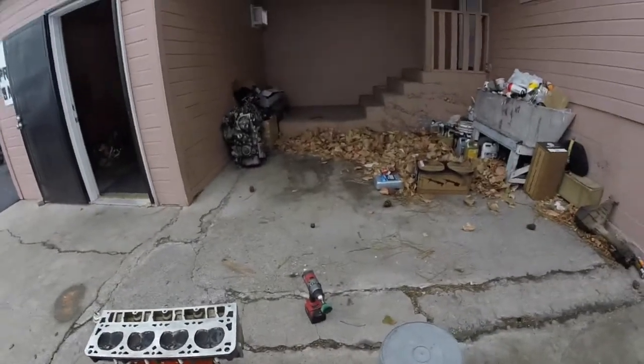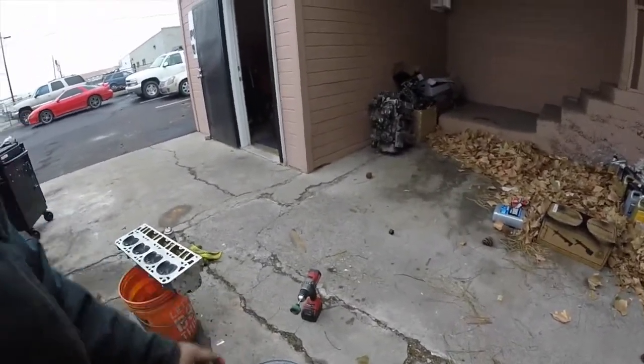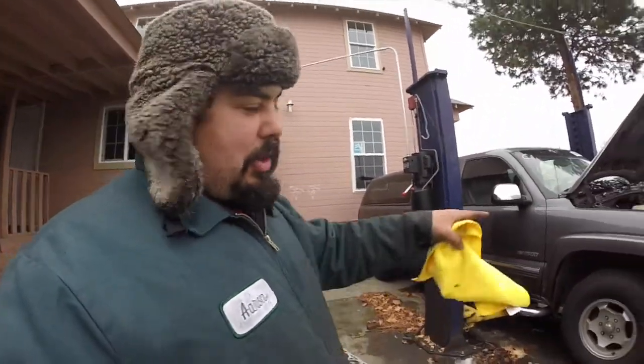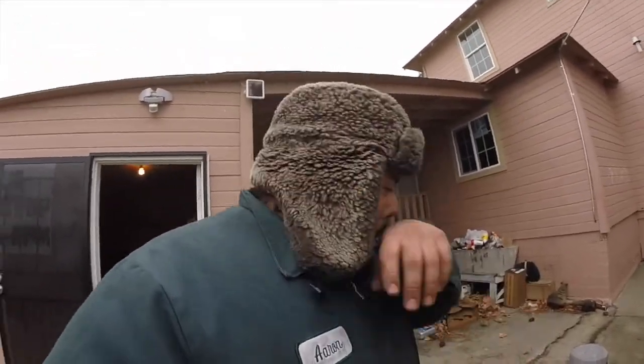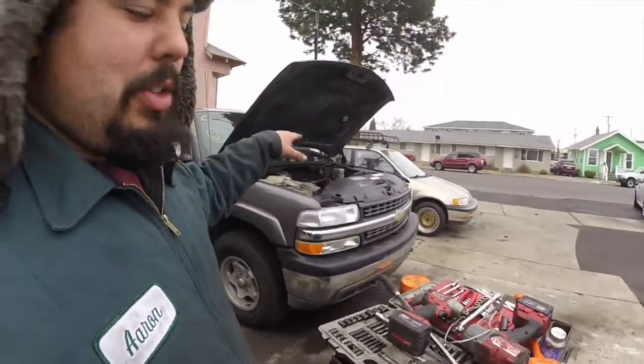So I know what a lot of you guys are gonna say, he Whiz-Wheeled it, and yes I did. I used that little buffer pad there, and guys, I've used that thing 100 times. I've never had a problem, I've never had a comeback. So for all you guys that are gonna say, oh, he scratched the head, that head's ruined, I'm gonna put that cylinder head on that truck, I guarantee you it's gonna run. And I bet you those head gaskets will last just as long as any other one. Let's get back to it. I'm going to clean that cylinder head, I'm going to clean the other side of the block, and then I'll show you guys how to torque it down.